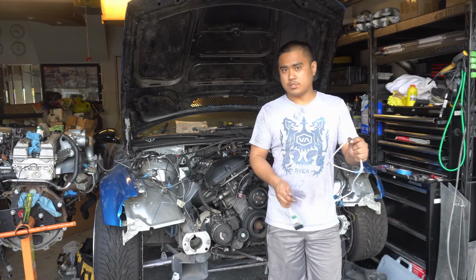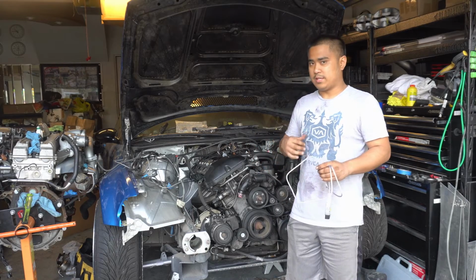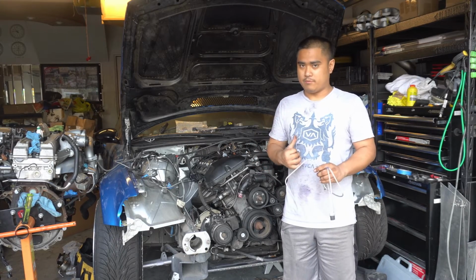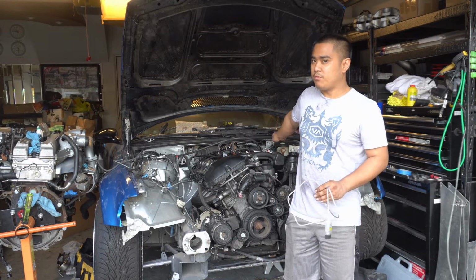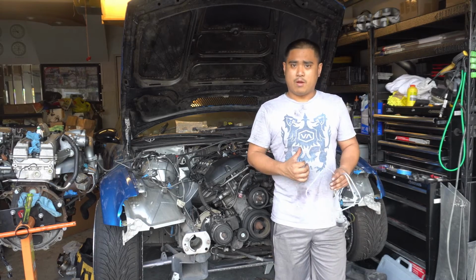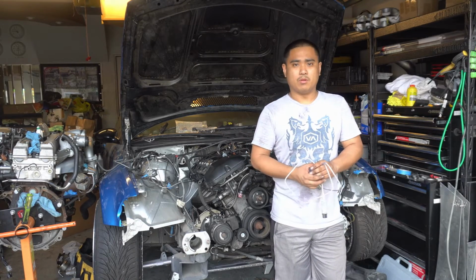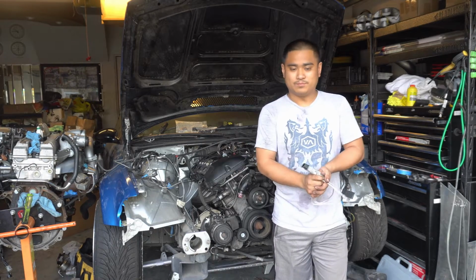Previously, you had to use, I think it was JM Garage Flasher, to get to the 512 kilobit file, which is the full file on the ECU. That would involve pulling the ECU and grounding a pin. Apparently with this new software by the MS43 development group, you don't really need to do that. So we're going to test that out today. Hopefully all goes well.